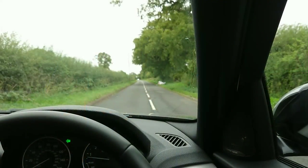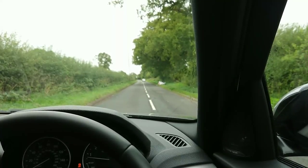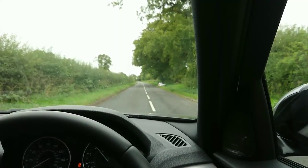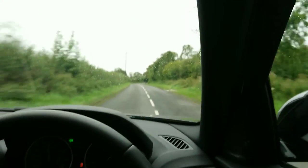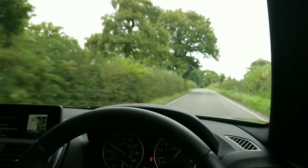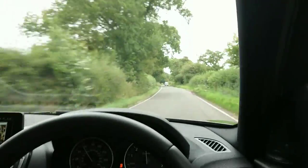So guys, let's now go and do that launch control. I'll find some tarmac which is unrestricted — hopefully this is going to be quite good. So we're going to do launch control in the M140i. The way we do that: we put the car into sport plus mode so the dynamic traction control is activated, put the gear into sports gearbox, slam on the brakes really hard, press the accelerator beyond the kickdown position, and then just let go of the brake. And the car has just launched itself ferociously. Wow. There we go. Oh blimey — that was flipping quick.